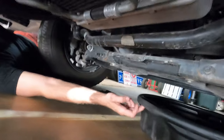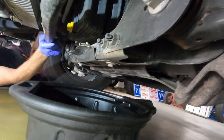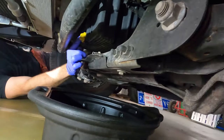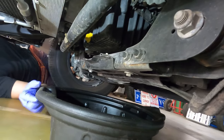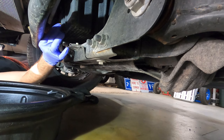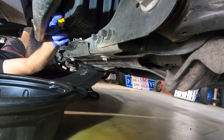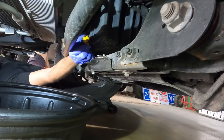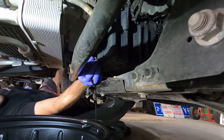I'm going to grab some gloves and the light so we can better see in this area. This is a quarter-turn drain plug. It's going to whoosh out pretty good, so keep the drain pan pulled back far enough. Go ahead and crack it loose, then work it a little more with your finger — twist it, twist it — and then you'll get it floated in the hole. Pull it back really quick and get your hand out of the way.